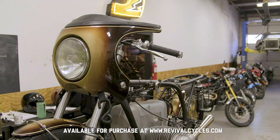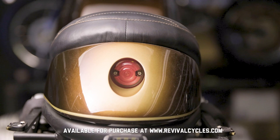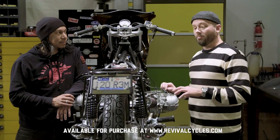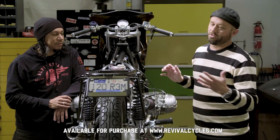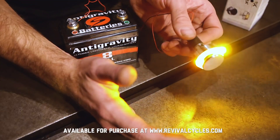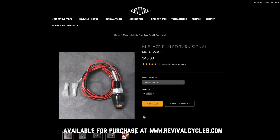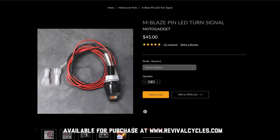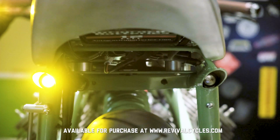On a lot of the bikes we do, we'll go in and update all the lighting to LED lighting, because while you're there, you might as well. It's a common thing to do at home and it's one of the easiest things you can do to upgrade your bike — change out the bulbs. You can find a factory replacement on our website that will go right into the factory tail light housing. It will be brighter, last longer, vibration resistant, and use less power.